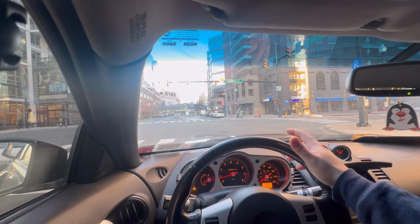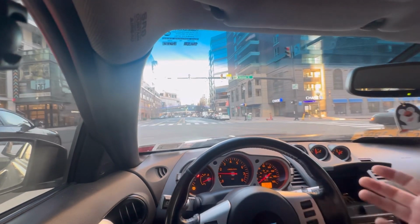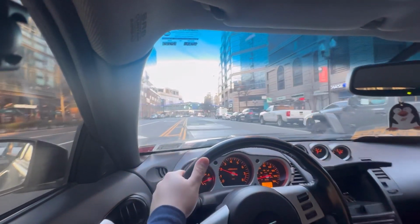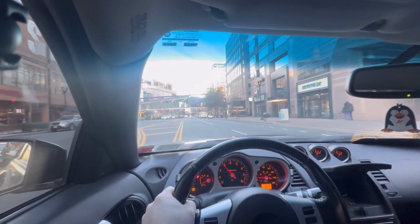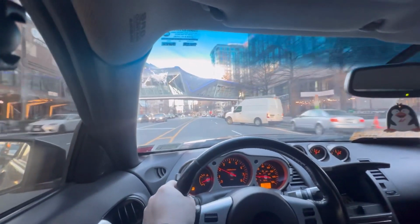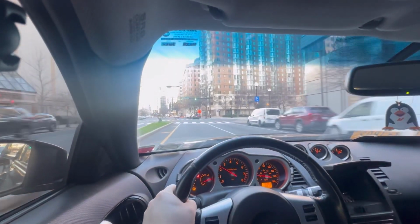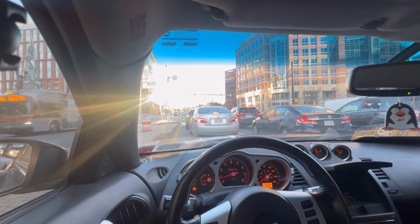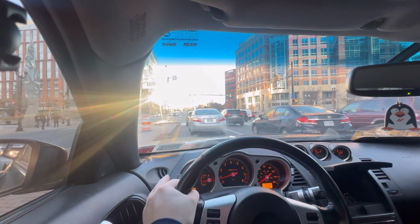I'm gonna be drifting this car. You know, I already welded the diff. That whole comfort aspect is already out the window. If this is just your cruiser car, your daily, and you need a transmission mount for whatever reason, I don't know if I'd recommend this one. It's good and it works great, makes the transmission feel good, but like I said, it's just a lot of noise.